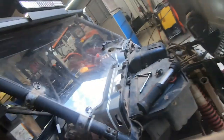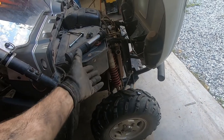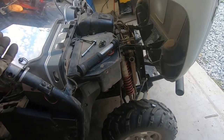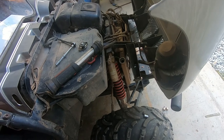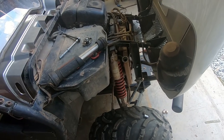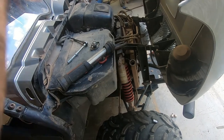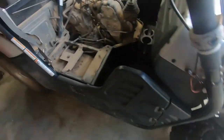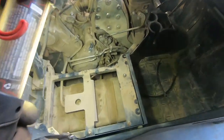I'm pretty confident the coolant is low. And why is it low? Well, I know it overheated because the over-temp light came on. I'm guessing that happened because the radiator gets plugged, because I hear over and over again — 'Oh, we ran it through the mud and now the over-temp light is on.' Why Yamaha wouldn't raise the height of this radiator so it's not clogging up with mud so much, and why they wouldn't make it easier to clean, I don't know, but they didn't.